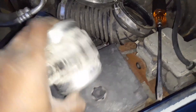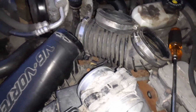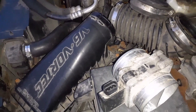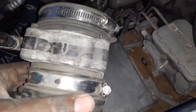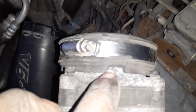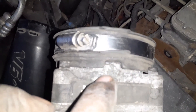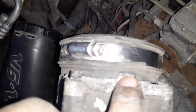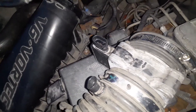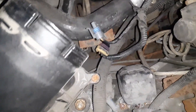It's self-explanatory — you put this back on the same way you took it off. Now, a lot of people don't pay attention to this: when I put the rubber seal on, I make sure the part that likes to flip up lines back up with these rubber sections. If you don't, your air intake sensor can act up — sucking too much air or sucking hot air. So just try to line it back up correctly. You can see it goes right into that groove.